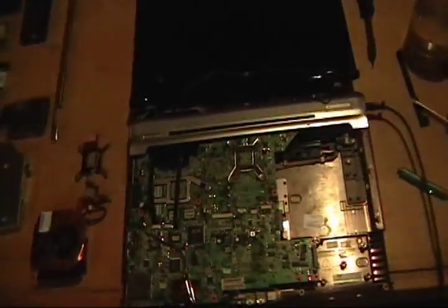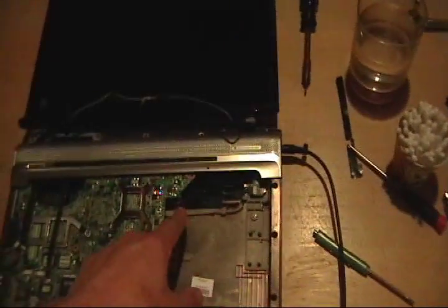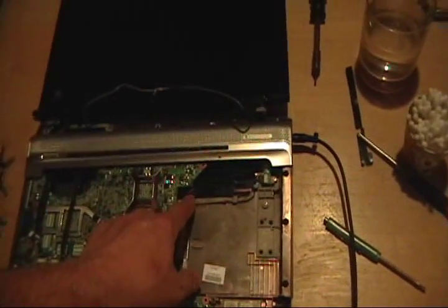The reball process is done. I've got the board on, got my power button on — I don't even have the fan or heat sink on. I've got the CPU in, the DC power cord plugged into the board, and one stick of memory in. You can see the blue line because it's plugged in. Turning it on — lights are good, staying on. There we go, we've got picture. Now I'm going to put it back together and test out the wireless card.